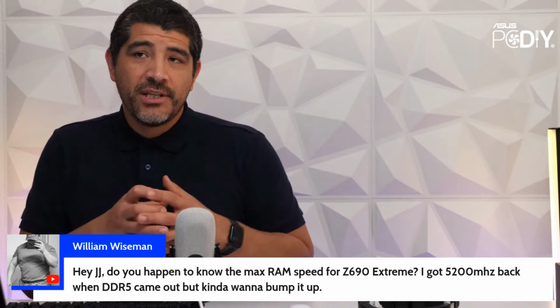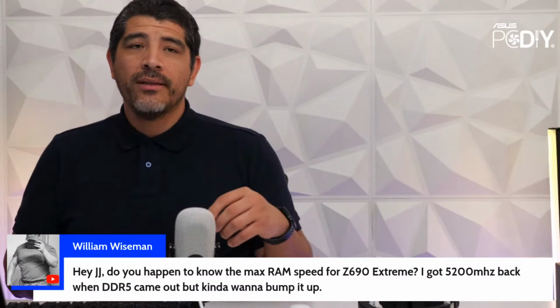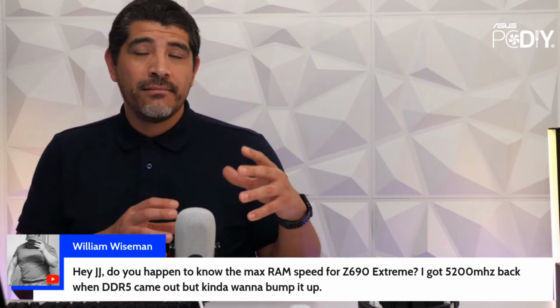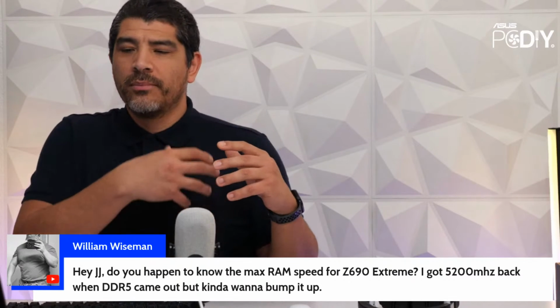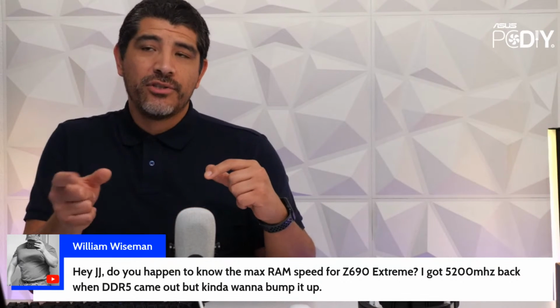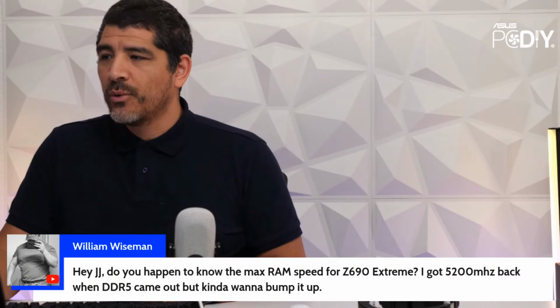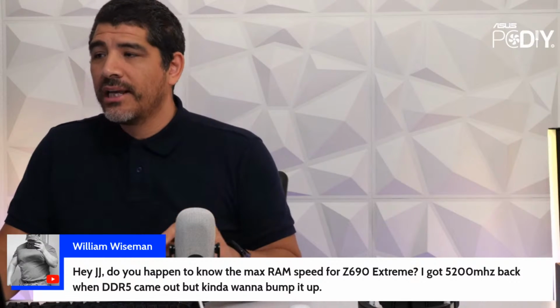But again, it depends on your CPU. If you've got a 12th gen CPU, then I would probably be targeting not more than maybe 6,400. And even then, that might run, but if you want a higher level of confidence, you said you've got 5200. 5200 is actually already a little bit of an overclock. The official memory spec for 12th gen is actually a maximum of 4,800.